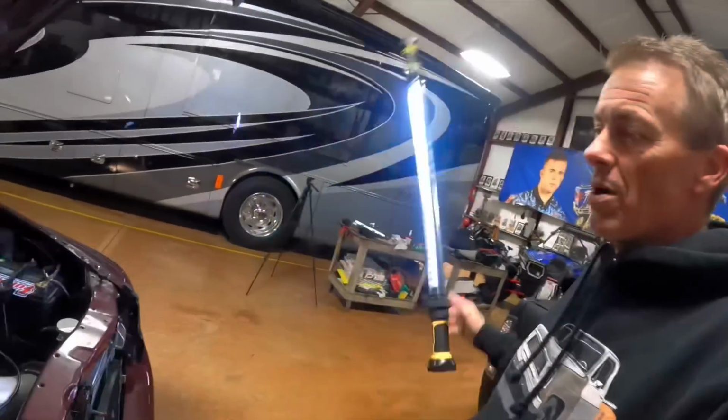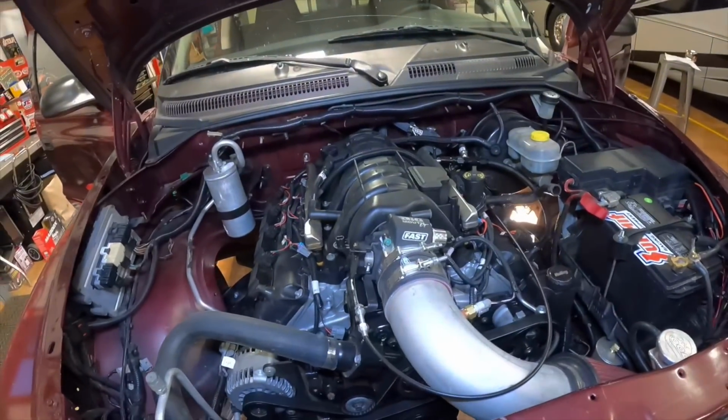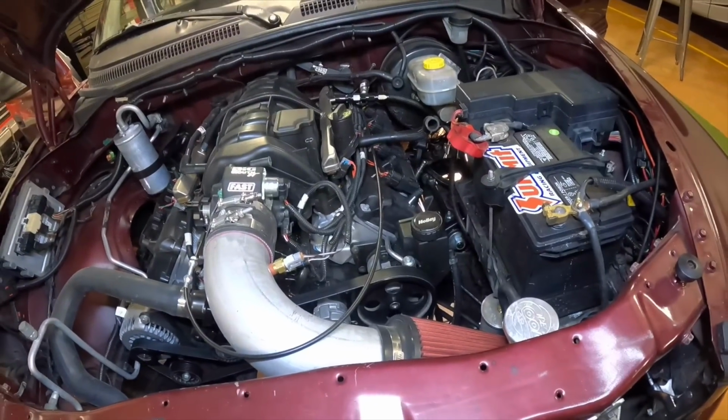A lot of folks said it'll never work. Been driving this thing every day for a while now. Runs good. Believe it or not, mileage is not bad. It's got a 4.30 Moser Engineering 9-inch rear gear in the back of it, but it has a Silver Sport 6-speed dual overdrive transmission, 0.68 in 6th gear. So you can cruise this thing down the highway no problem, even with a 4.30 rear gear. And you can also have the rubber buildup problem on the back quarter panels. Again, I gotta look into that. I don't know why that keeps happening.